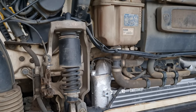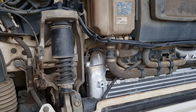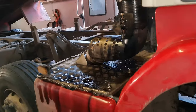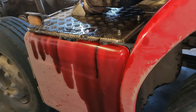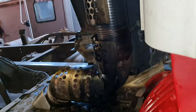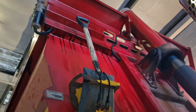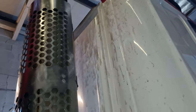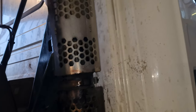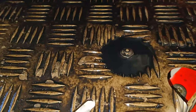So all the cold side of the turbo system — the air inlet system — was cleaned and replaced. However, what they failed to do was clean the hot side. This is the exhaust, this is the cat, this is the stack. As you can see, it has shot a load of oil out all up the back of the cab. All this black stuff is just dirt-infested oil.